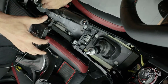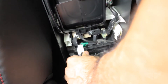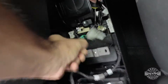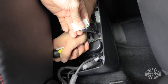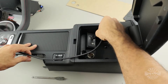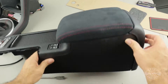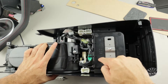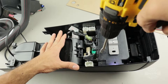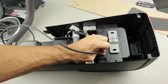Now there's one more hole to drill. Back inside the car, carefully tilt the center console all the way back so you can access the cables under it. There are three plugs back here that we need to unplug — make sure you push in the tabs before pulling. Sometimes a flathead screwdriver makes that easier. This cable is secured to the console with a retaining clip, so use the screwdriver to push on the sides to get it out without breaking it. Take it to the bench — our goal is to have this cable go under the console, so we need an access hole. Flip it over and drill right below where the cable will end up plugged in, using a 5/8-inch bit, just enough to fit the head of the USB cable. Pulse the drill, clean up, and test for fitment.